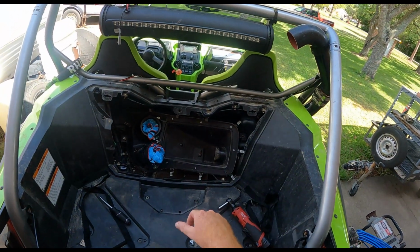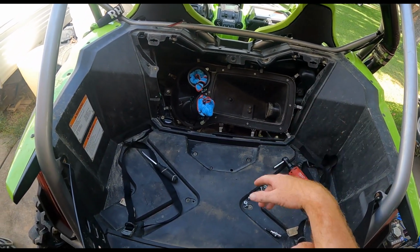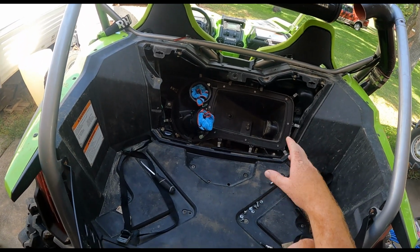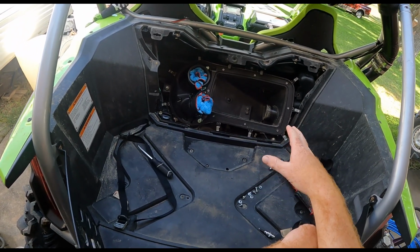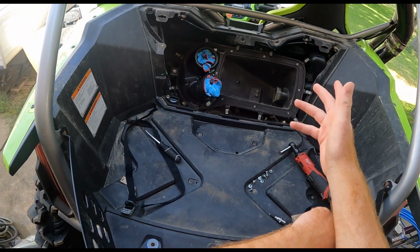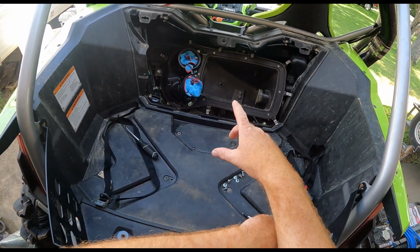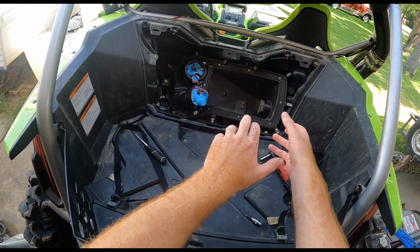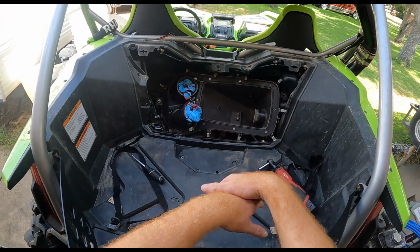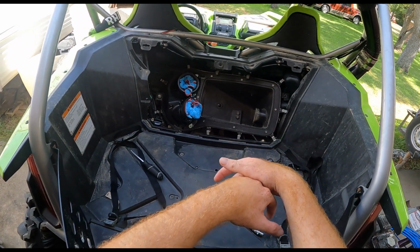But anyways, guys, that wraps up today's video. I've got the air filters and stuff sitting over there in the sun to dry. Whenever I go to put them back in, I'm gonna spray some generic air filter oil. I'm not gonna spray the actual filter itself, but I'm gonna spray that red sock that slides over it, just to kind of help keep the dust and stuff dormant, that sort of thing.